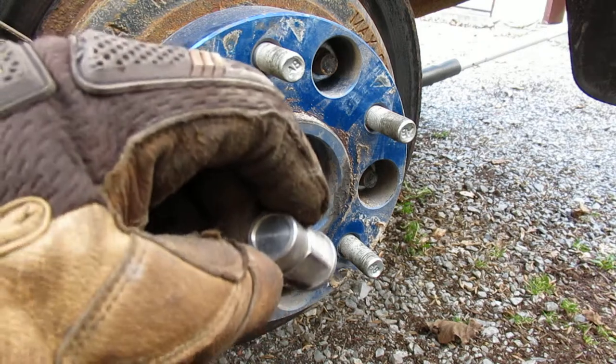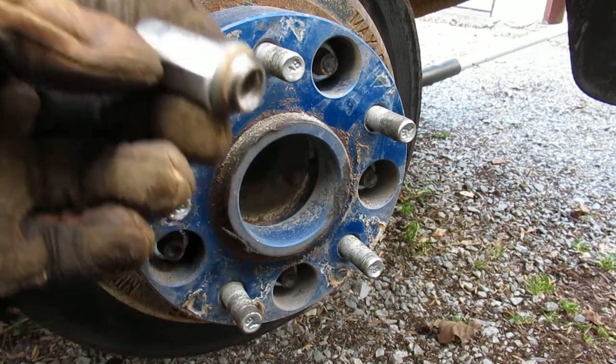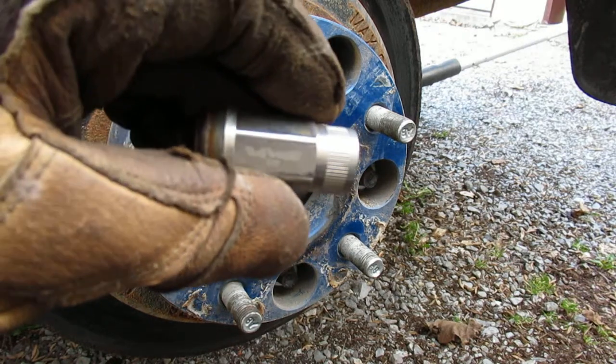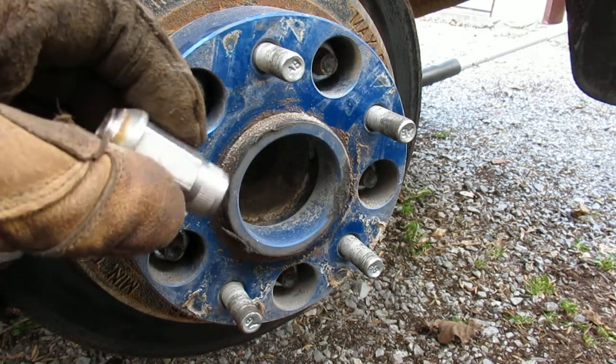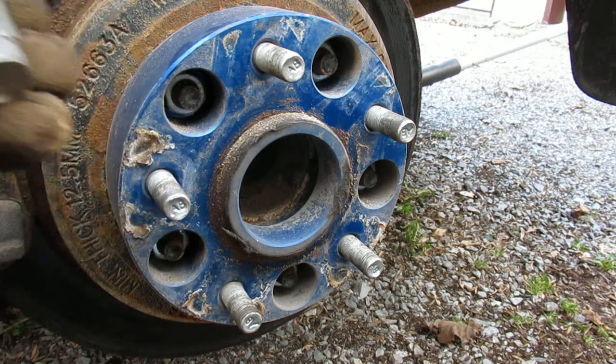The last little bit: with my aluminum wheels and stainless lug nuts I have problems where they gall against the aluminum before they really get tight. These are VMS — if you can see that — they're actually pretty cool. You could polish them up and keep them looking sharp, and they don't fall apart like the factory ones.